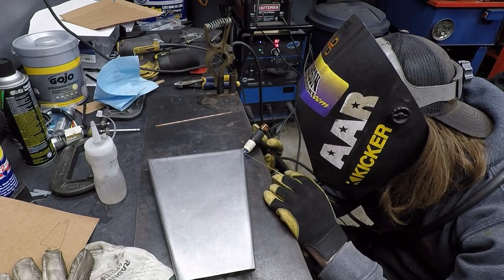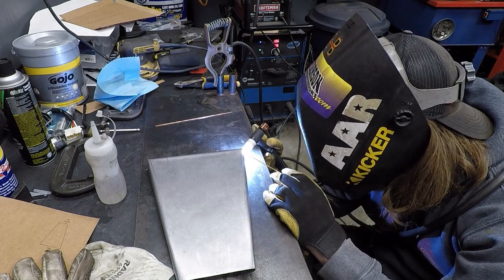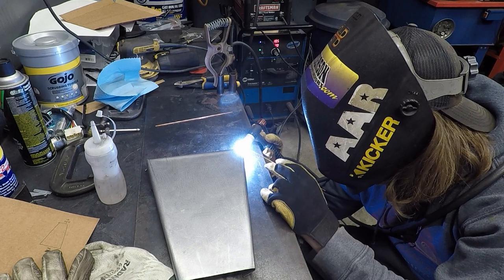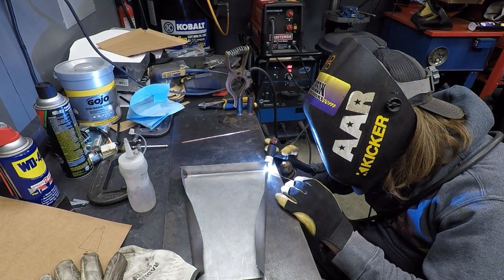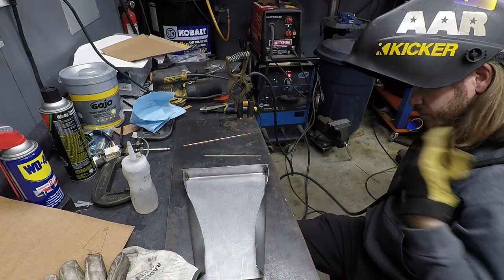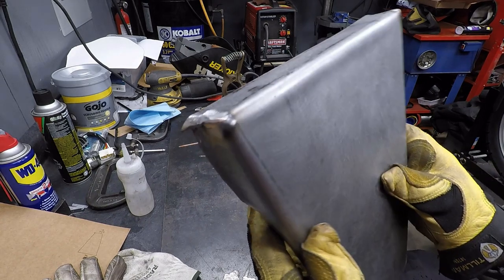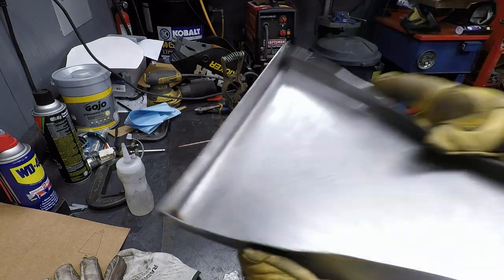Once the rear is kind of in shape, I can go ahead and weld the corners. The seam that is folded upward in the back and on the sides will create a little bit of a seam, and if I don't weld it now it's going to be very difficult to weld whenever I get it on the bike permanently. I'm using my TIG with silicon bronze — a lower amperage filler rod — which allows better control and prevents burn-through on this 16-gauge steel. I weld both corners up and then sand them smooth with a flap disc. I only welded about halfway up because the other half we'll form into shape and weld on the bike.